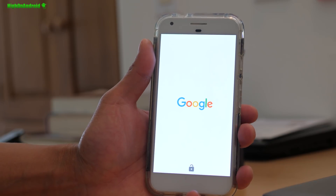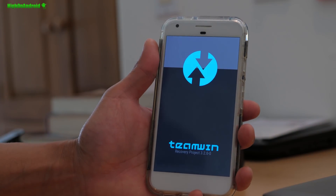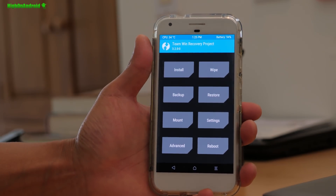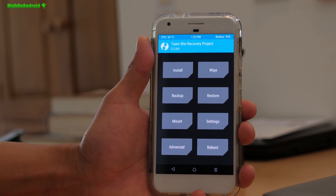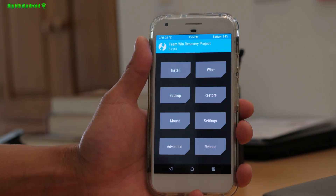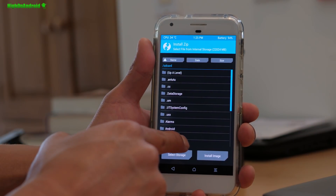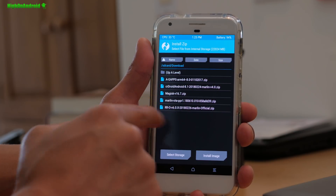On phones like Pixel 2 and Pixel 2 XL you do have to flash the TWRP zip installer every time you install a new ROM or do an OTA update. If you lost TWRP, simply reboot into your system; if you have root, use the Flashify app to flash TWRP without a computer, then continue. Now, if you're coming from a custom ROM like me, you'll need to go to Wipe and do a factory reset. If you're coming from stock firmware and just want the OTA upgrade, do not wipe — go straight to Install.